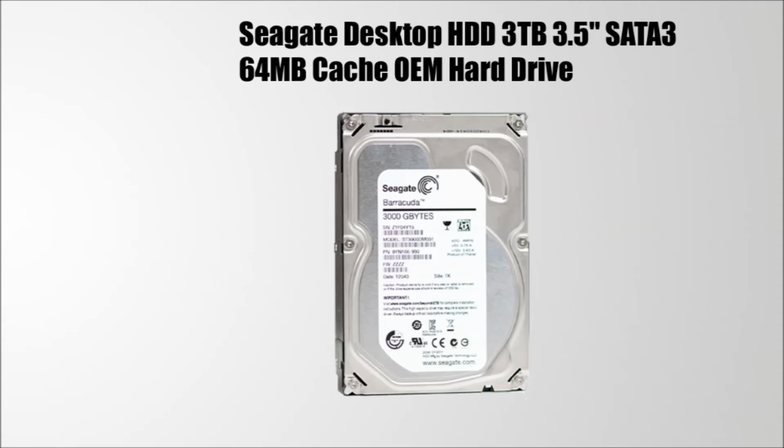This is pretty standard. Also, one thing to note is that when we're getting 3TB hard drive disks, make sure you format and create a new volume in order to get the advertised 3TB of space. For some reason, there's a 2TB ceiling, and you have to manually change it. Other than that, there's nothing much I can say about this.